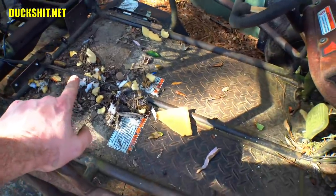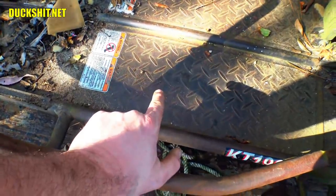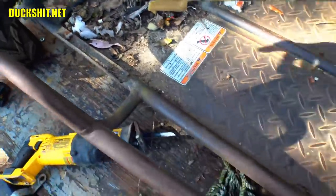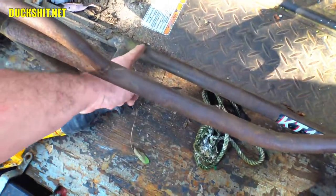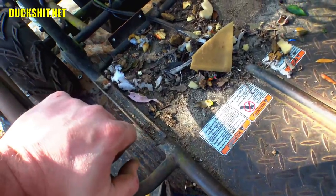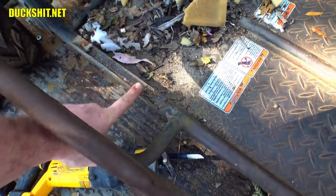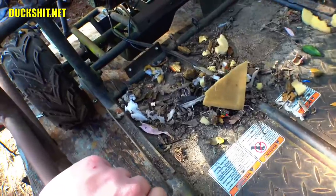But yeah, we do need the sheet metal to move forwards, because it would be nice to not disrupt the pattern that's on it. Because if I cut it and space it or any of that stuff, it's gonna disrupt how it looks. Yeah, so we'll cut it along from the corner to wherever my cut mark is gonna be, which probably I should make it around here to make the cuts minimum, and then I'll just weld it all back together wherever it sits. So that should work out fine. And then the best part is, these brackets that are here are still gonna be usable for whatever type of seat that I decide to put in here.